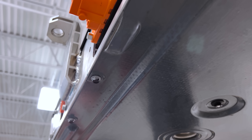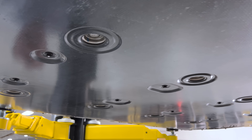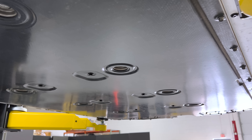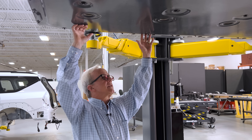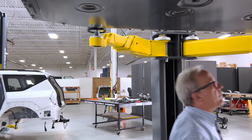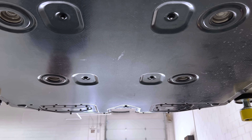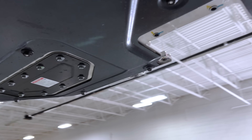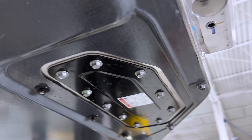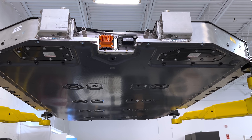One big purpose is thermal insulation: the ambient environment gets hot and cold, and aluminum very easily couples into that ambient environment. If you're trying to heat your battery and it's cold outside, the ambient cold tries to cool your cold plate. This composite provides a thermal insulating layer that gives you at least some isolation from the ambient environment. Also of interest underneath, there are some serviceable components — mainly for the battery pack — that are available underneath access plates without needing to drop the battery.